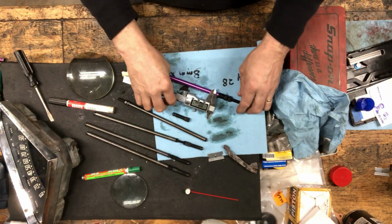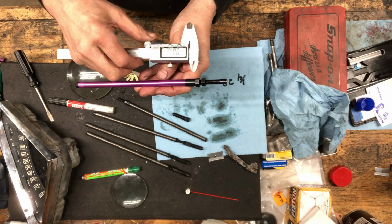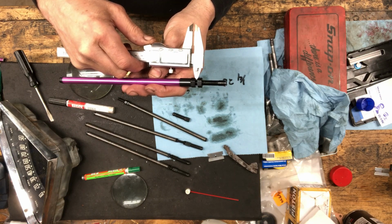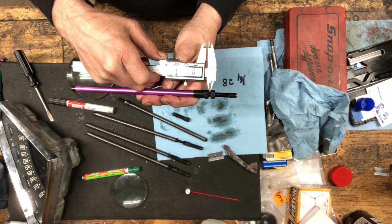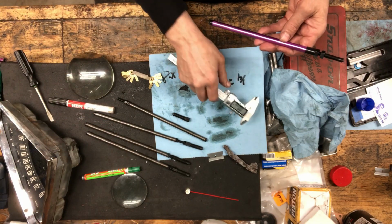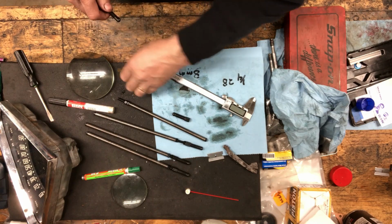Okay, I just wanted to see how much I was out from 3.19 turns to 4 full turns out, and I just zeroed this. I got it set to 4 turns out. That's what I had them all set at. And I'm out like 23 thou. So I've compressed that lifter 23 thou, and I'm getting tappet noise. So just for reference for anybody else stupid as me, make the same mistakes.